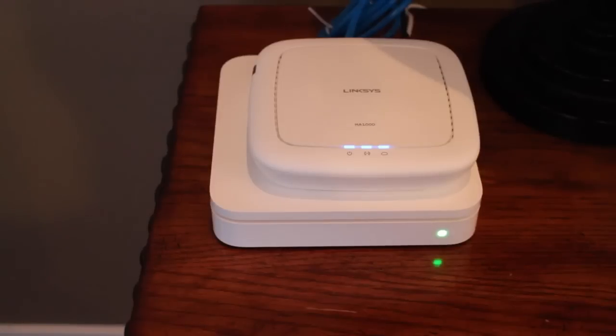I have the Staples Connect Hub sitting on top of my older Airport Extreme. This does require you to connect the Staples Hub directly into the router, so you must use ethernet, and then of course the Connect Hub needs power. That's really all there is to it — once you have the hub connected into one of the available ethernet ports of your router as well as power into the wall, you head over to the Connect app, which you can download for either iOS or Android, and use that app to first set up the hub and then set up all the different devices you want to add.